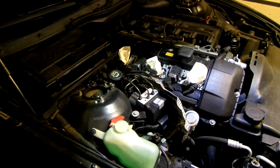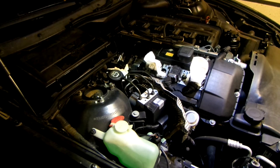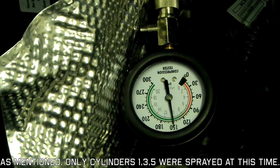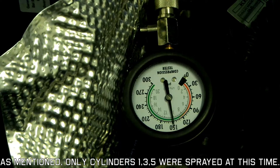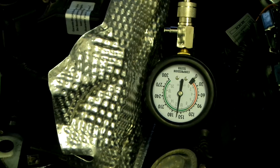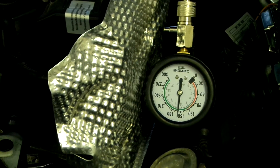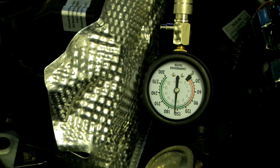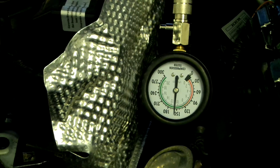After those 20 minutes you are supposed to flush the Torlin out of the cylinders, but the paper towels were dry. Let's check the compression. Cylinder 1 was the same value as before the test, and cylinder 2 as well. But the 4th cylinder — massive improvement. This confirms that the carbon buildup was the cause of the low compression and that the product works. Definitely money well spent.